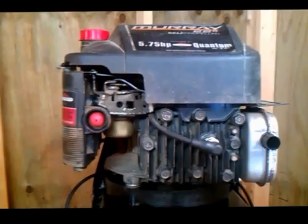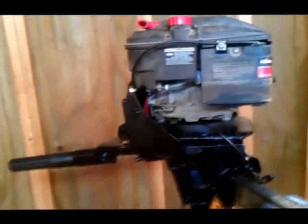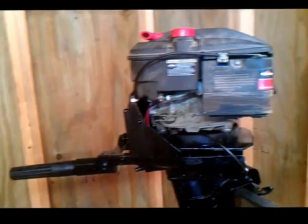I am having a problem with my neutral - can't seem to get my adjustment just right, but I'm gonna work on it. Anyway, I want to show you guys what I've accomplished. There's my throttle - it pulls out wide open and that's closed - and this is the kill switch, just a push button. That is the front cover plate of the original boat motor. Now it's a four-cycle five-and-three-quarter horsepower Briggs and Stratton engine, where it used to be a two-cycle Tecumseh seven-and-a-half horsepower.